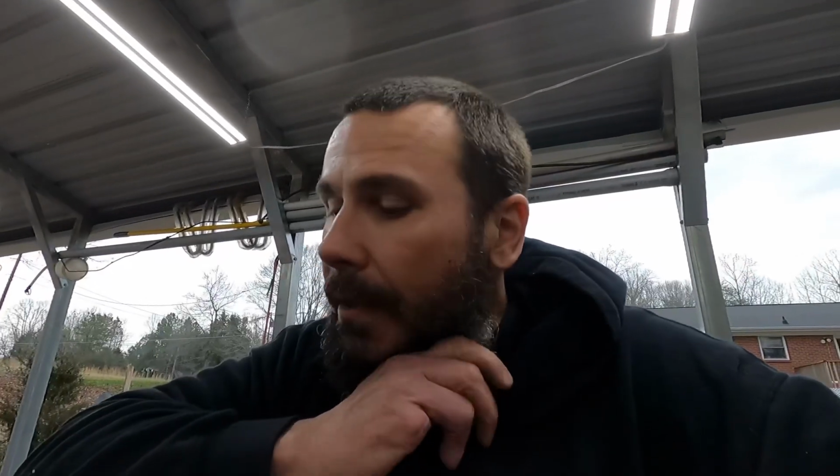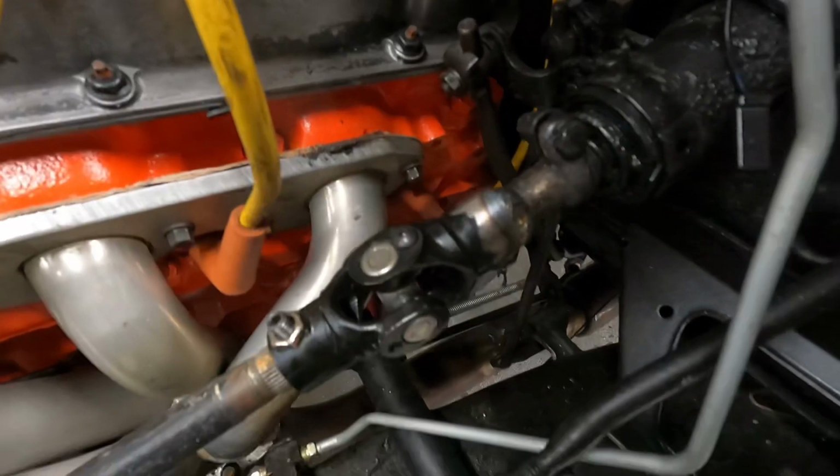But I worked on the shift linkage basically all day Sunday, and finished up the steering shaft. I actually just went ahead and welded those U-joints in. I didn't really want to do that, but I didn't feel like hauling them back to work. Both manual mills were either set up or had been used for something other than straight vertical milling. I was going to mill flats on the shaft and drill and tap for 2 set screws on the slip fit end of these U-joints. So I just welded it there.